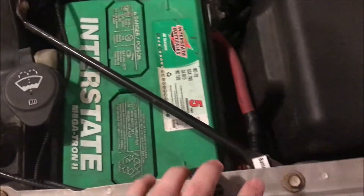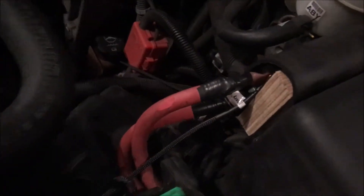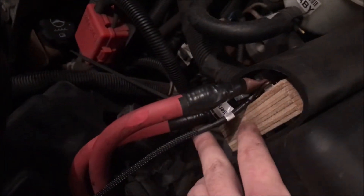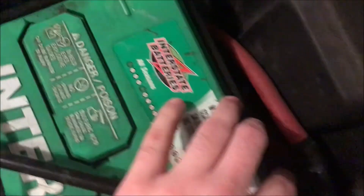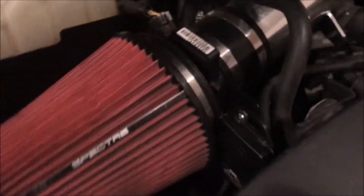For these HIDs they suggest you use a relay kit so you get a dedicated positive and ground. Here on the back side of this bolt is where I ran the negative. I have an aftermarket audio system, so this is just a positive fuse block that runs to the positive. Here's one of my ballasts — the ballast is what gives it power. And here's where I mounted the other ballast next to my cold air intake.